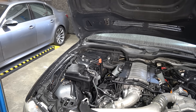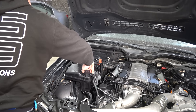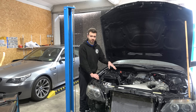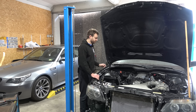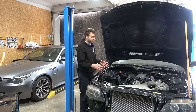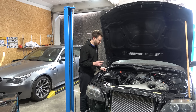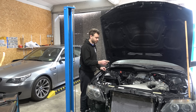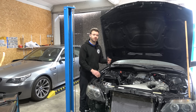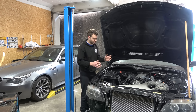Now we're adding coolant — climate control set to highest temperature. This thing takes a lot of coolant and I don't see or hear any leaks yet, which is good. Pretty much everything on the top end is reassembled. We still need the prop shaft, the exhaust, and then it's ready to run. But first, we're going to crank the engine over without fuel or spark to build up oil pressure. I'm removing all the spark plugs so there's no stress on the bearings while it builds pressure.